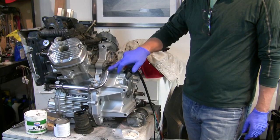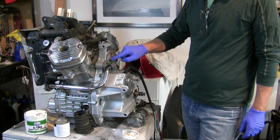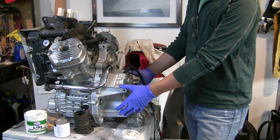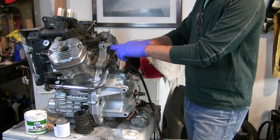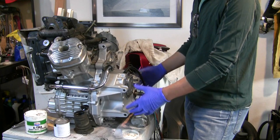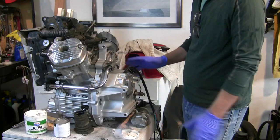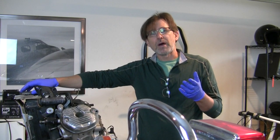I need to remove this coolant tube again, take the water pump apart, remove the impeller, which will release this whole rear case. The starter's got to come out — that wasn't a big deal — but then I've got to take all of these bolts off the back again, pull the back off, put those two washers on, and put it back on. All said and done, it's a considerable amount of work.